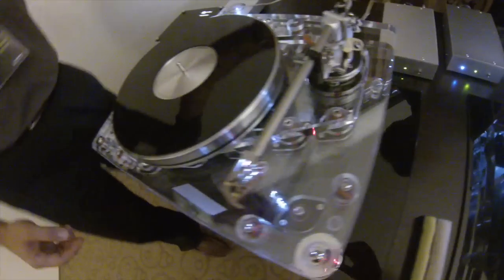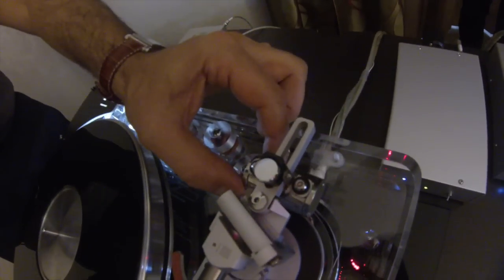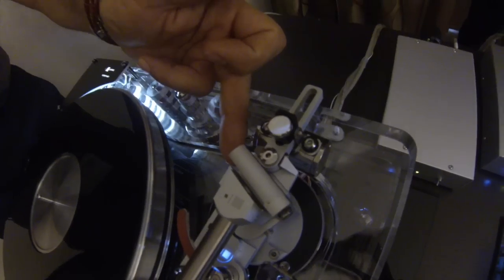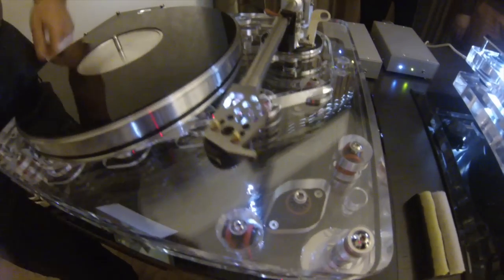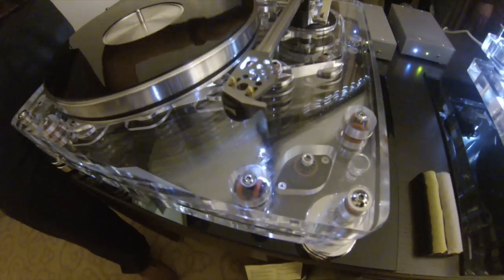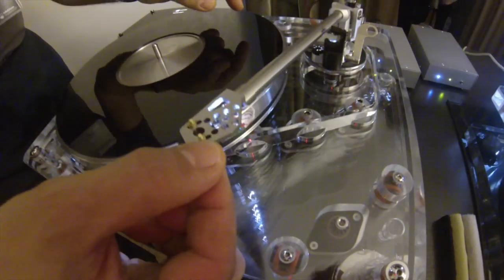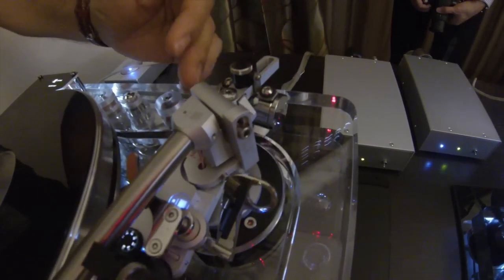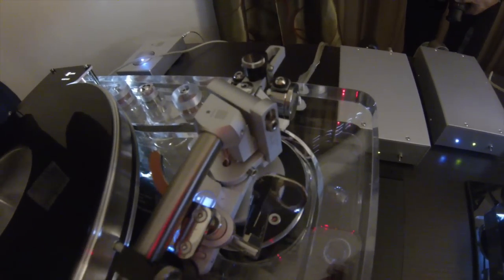And also the counterweight, we're using the same principles as before. So you articulate it sideways and you articulate it this way. Because the center of gravity is lower than the bearing point and it's in line with the stylus tip, any pull on the stylus doesn't push the arm up or down. But if you have a warped record and the tone arm is doing this, the pivot point is through 2 precision ball races up here. So as the arm goes up, the distance from the counterweight to the bearing slightly increases, and as the arm comes down, it reduces.